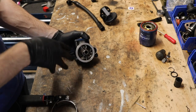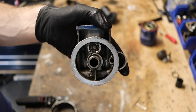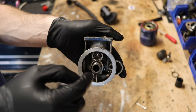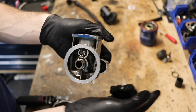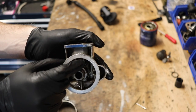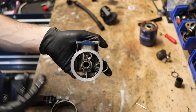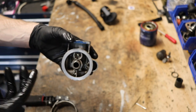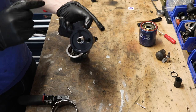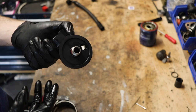Now we've got the head out of the car. As you can see, there's a little ball valve inside that filter head - that's a bypass. Oil is going in right here, down through this hole, through the whole filter, and then being sucked through this small hole out and into your motor. That's a tiny hole. What the MED race head does is it removes that bypass and only allows oil coming through the filter to go to your motor, which means you always have filtered oil. And as you can see, this hole right here is much, much larger - so a larger volume of oil is allowed to pass through.